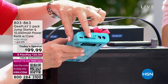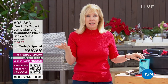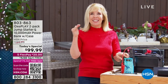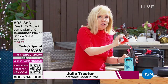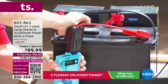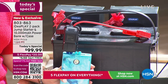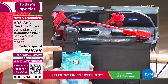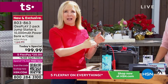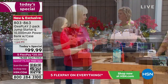A lot of people with the old-fashioned jumper cables do it wrong because they don't know where red and black are — it's hard to tell in the newer cars. I'm going to do it wrong, because this is the only one in the industry that has an audible beep. I'm doing this backwards — instead of red to red, black to black, I'm doing it opposite. There's a beep. There's also a red light. If you can't see the red light, it's not a problem because it's beeping and telling you you did it wrong. Then all you have to do is switch it around — no sparks, it's not going to ruin your battery or engine. So much safer.